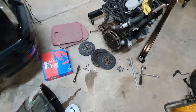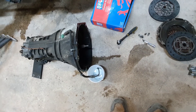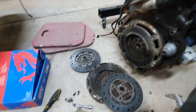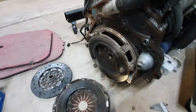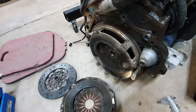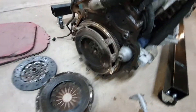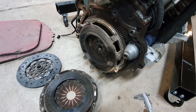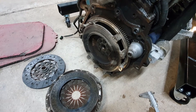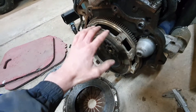So, onto the clutch — I've just pulled the engine out this morning. The clutch slips if you do a little burnout; sometimes the tyres are producing the smell and sometimes it's the clutch. It used to have a dual mass flywheel on it. You can see here — this is a lovely, lightweight flywheel. It weighs around about a third of the weight of the dual mass flywheel, so it really lets that engine rev very freely and opens up performance hugely in first gear, noticeably in second, and of course the effect tails off the higher the gear. Wow, it makes a difference in first — it's quite incredible.